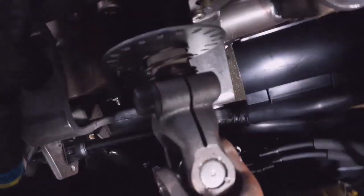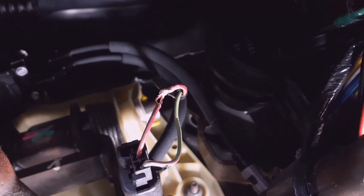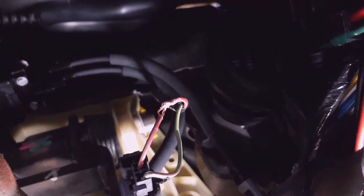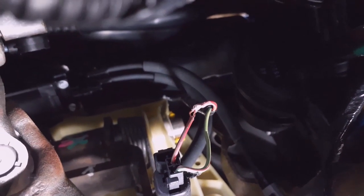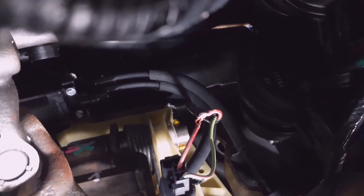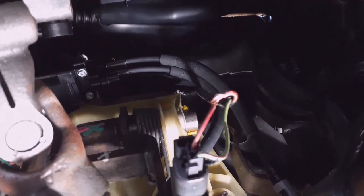About the poke and wrap method — you see I opened that wire up right there. I put the wire through that loop, through the hole, close it, wrap it up real tight, and tape it tight. It's easier than soldering because some spots up high you can't get to with solder, you burn yourself, and solder can get really messy. Plus if they wanted to take the alarm out, just pull it out, tape it back up — no messy solder. I've been doing it this way for years — I call it the poke and wrap, kind of military style.